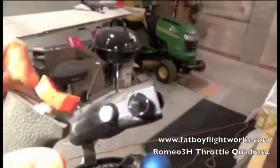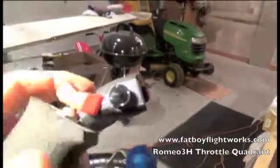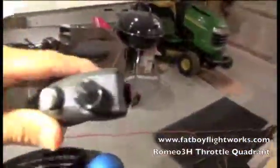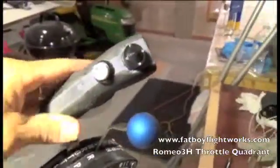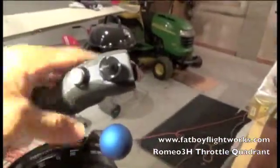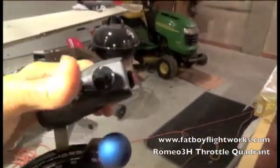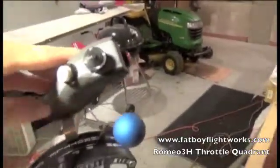And this one is a maintained side and a momentary side. But you can get one that's a little bit smaller than that, and that can sit right up here on this high thumb position. You can actually have it sit over here as well, if you want to set it up side to side and do a rudder trim here, however you want to do it. And then we also offer an alternate maintained push button as well. So if you want to activate a circuit and then deactivate, it'll stay maintained until you hit it again. Smoke systems or any kind of circuit where you need that type of operation.